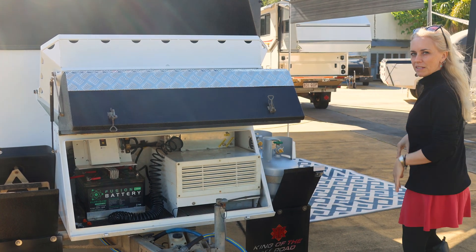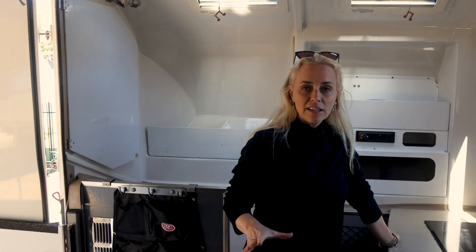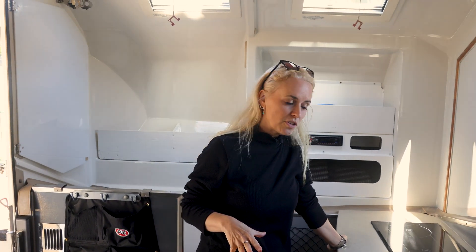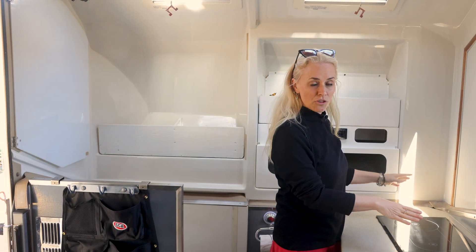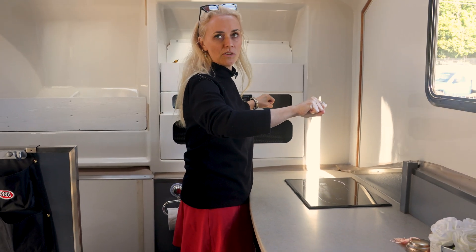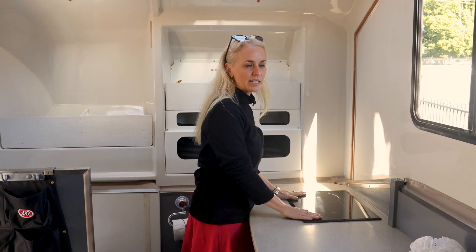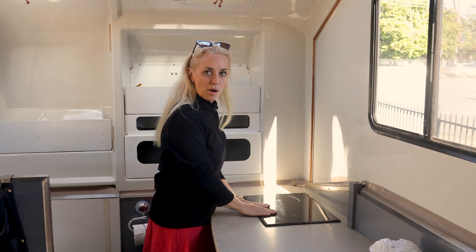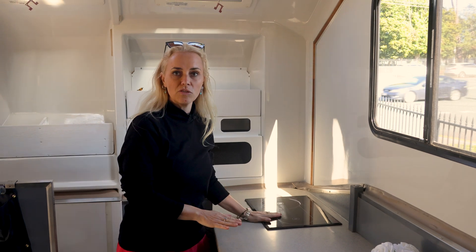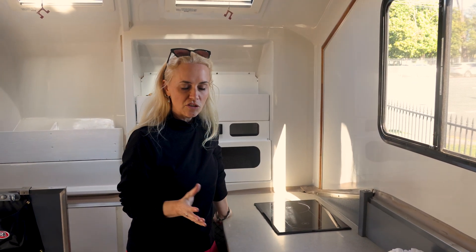In the older systems, on any unit that's a pre-30th anniversary unit, this is why the cooktop was placed right by the toilet unit — it meant those wires were shorter so you weren't losing voltage when using the cooktop. This is also the reason why older units, anything pre-2018, probably had a diesel cooktop, because you weren't using battery power and just had a different system for cooking.